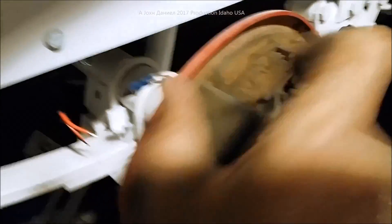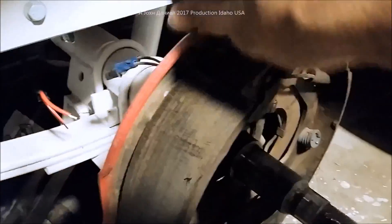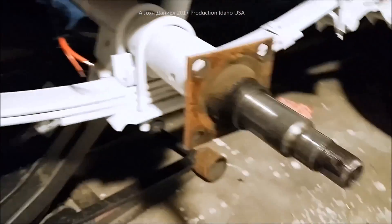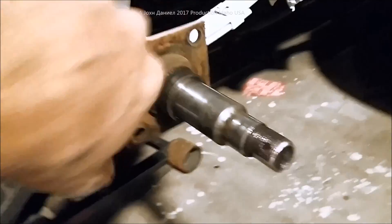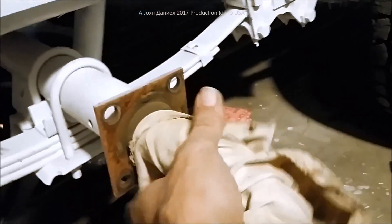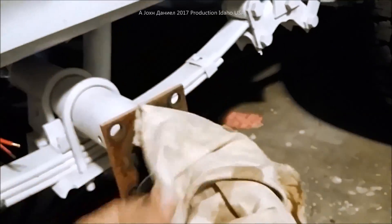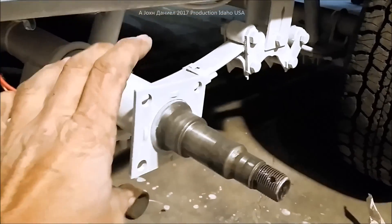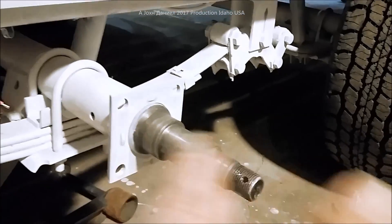This brake is ready to come off — the wires have been cut and prepped for the new brake. It comes straight off and will leave your nice big dirty flange, which I'd suggest cleaning up and painting like the rest of it. Lay a rag over the top of your spindle, wrap one around it, and then paint to protect the surface of your metals. Now we have the spindle and brake support cleaned and painted and we're ready to get these brakes on.